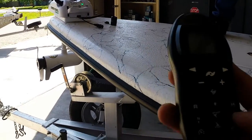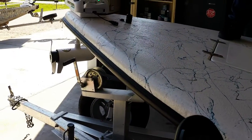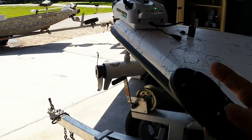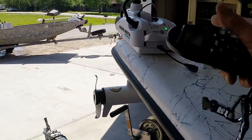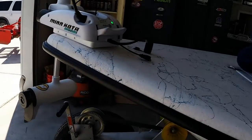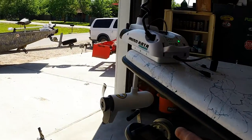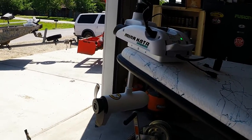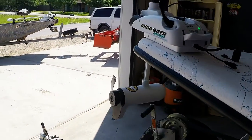What the anchor button enables you to do — instead of having to drop your power pole or anchor while fishing — you hit a spot, a little reef out in East Bay, wherever, and hit this anchor button. This trolling motor will keep you positioned within three to five feet of that spot. There are GPS receivers in here, utilizing up to seven or eight satellites at once. Even with heavy winds and currents, I've used my iPilot at the concrete ship in Galveston with the tide ripping in, couldn't get an anchor to stick. We dropped the trolling motor, hit the anchor button, and it locked the boat — didn't move.